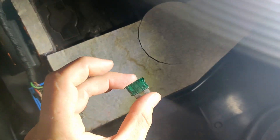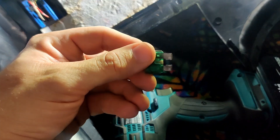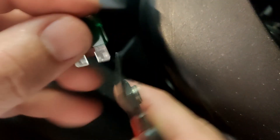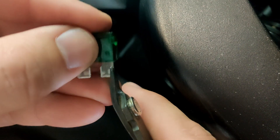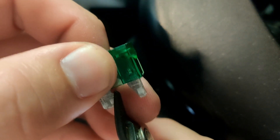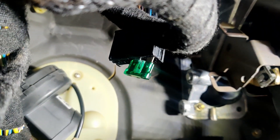On the harness that this connects to, you're going to want to jump those two pins out using a 30-amp fuse. Go ahead and connect that to the harness and crank it, and you'll be able to tell whether your starter is bad or not. Shave some of the blades of the fuse down a little bit in case it's too big to fit inside the harness. We've got the fuse there on the harness — go ahead and crank the car and see if there's a problem with the starter or not.